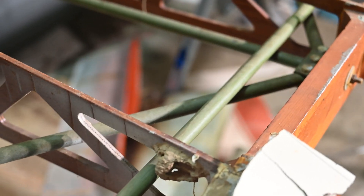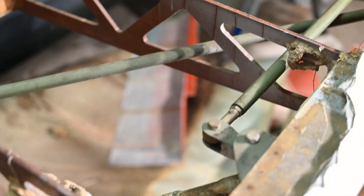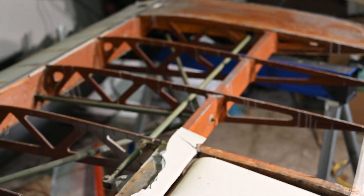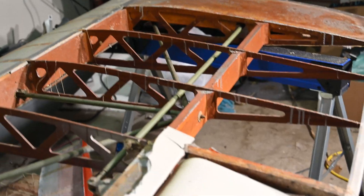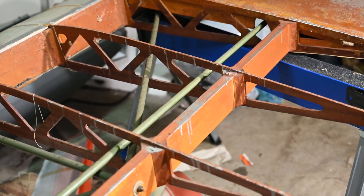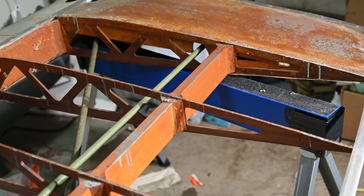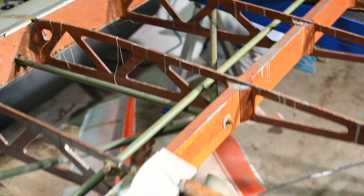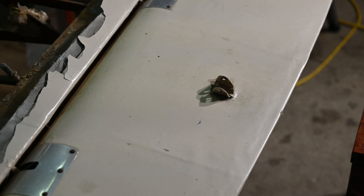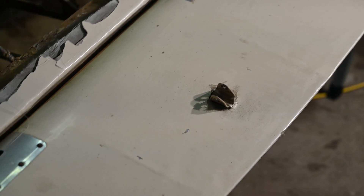Let's do some more close-ups of the metal and how it's looking. That pushrod coming down there is what moves the ailerons. You can see as the aileron moves, that rod comes up, and that rod goes into the fuselage and connects with the rod from the other side — the two rods come up together, and that is how the ailerons work. There is a connector that goes up from here to the aileron on the top wings to make those work, so everything ties through the bottom wing and connects from the bottom aileron up to the top aileron.